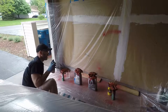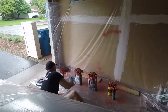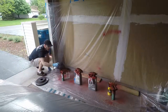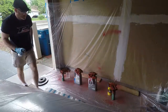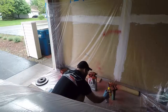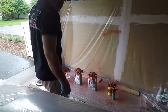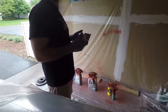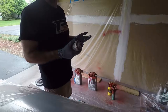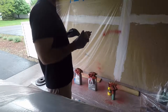I'm so impressed with how nice this can sprays. That was a little bit heavier coat — a full ten minutes of cure time on this one. It's much more even and looks a lot nicer. The first coat is a very light tack coat. Tack coating is a term in automotive painting where you just very lightly cover the surface to get something tacky on there for the subsequent coats to stick to.